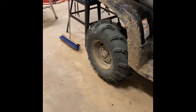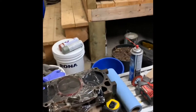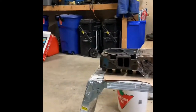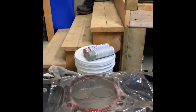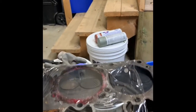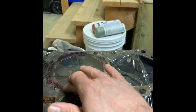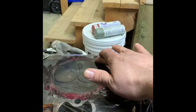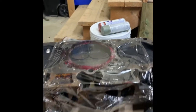When I decided to take down that 440 sitting on the engine stand over there, I noticed I had one cylinder that had water in it, so it's going to need rebuilding. When I called the guy, I'm trying to figure out — because I want to get to a 9 to 1 compression — and everybody seems to think these heads are, I don't know, they're all over the place. So it makes a difference on what pistons I buy.